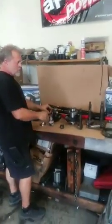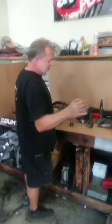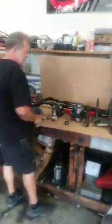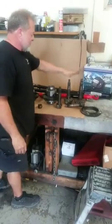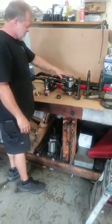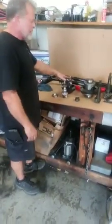So we pretty much went over what breaks gears, what other things can happen with gears as far as the idler spider gears and whatnot, the different gear sizes for vehicles. This is out of a one ton. This is out of a 3/4 ton, basically. This can go in a 3/4 ton also, but more or less for like a Jeep half ton, stuff like that. This is pretty specific for a vehicle that doesn't have a whole lot of towing.